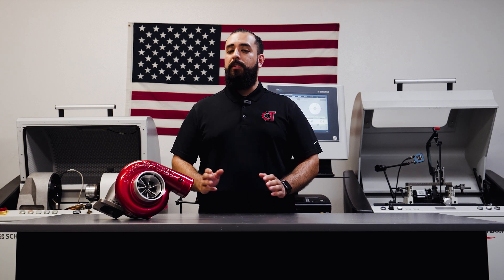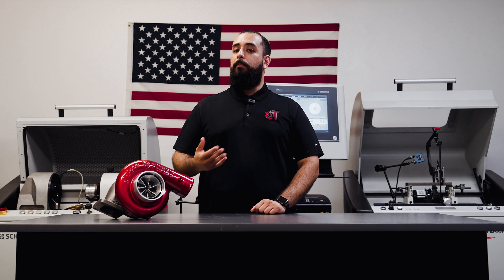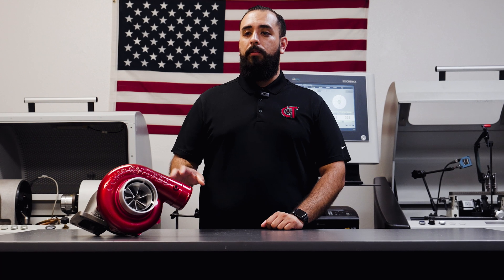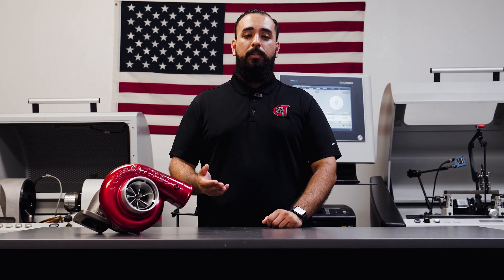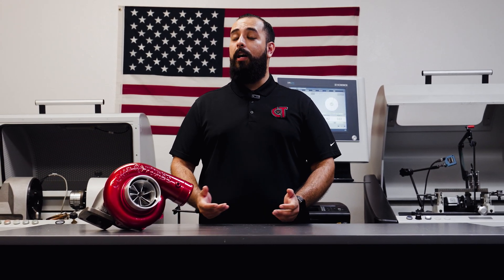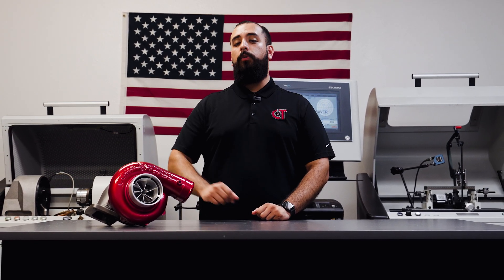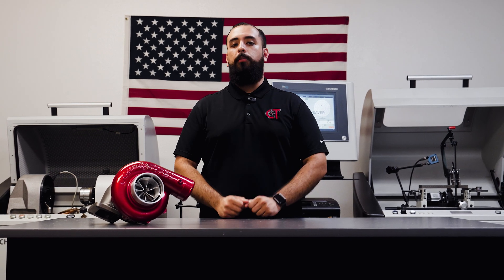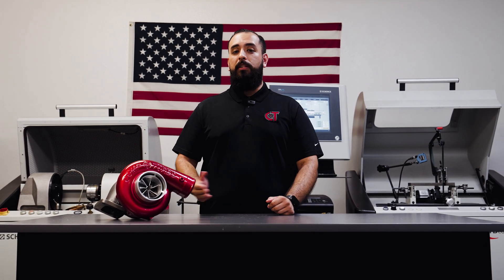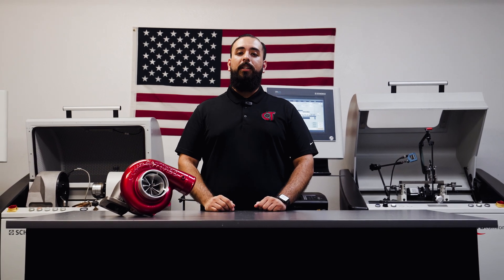The air-cooled turbocharger needs no plumbing at all, so you can mount it underneath the vehicle, behind the vehicle, or even in the bed of a pickup truck. These mounting options are more niche, and if you need help deciding which works better for you, you're welcome to call in at any time and we'll happily answer all questions. The air-cooled combination is available for any and every turbo combination we offer — any size and any turbine housing, T2 to T6 and V-band in a few different sizes. Don't hesitate to call in. I'm Eddie Rocksteady and I'll happily help you out.